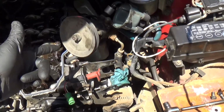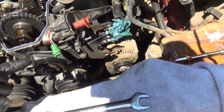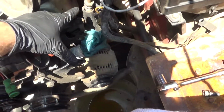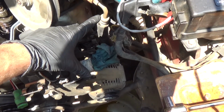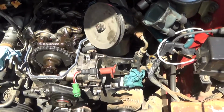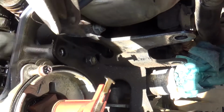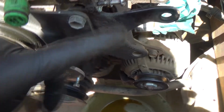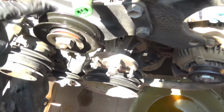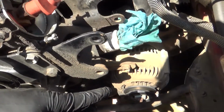But what we're going to do now is I'm going to explain. I got the power steering pump out. I was running into some issues before with the bolts here, but I realized that the power steering pump itself is actually only held in by these 2 bolts right here on either side of the bracket. So all you have to do is get this one and it'll come out, and I just kind of have it off to the side for now because there's not much room to move it unless you take all the lines off. So next what you have to take off is, I took out one here, and you have to take out another bolt right here, and then these 2 bolts, and then this whole bracket should come off, and then you'll be able to take off the tensioner for that, and then we'll move on to the alternator down there once I get this off.